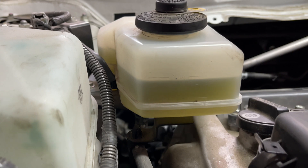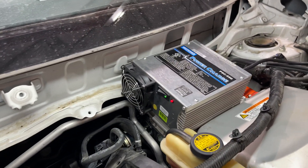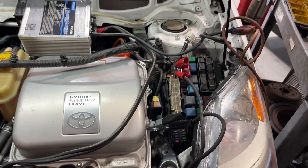One other note: you need to make sure that the brake fluid is always at max, checking it constantly. Also, I like to hook up a battery maintainer while doing this job because the car does a lot of stuff electronically, and I don't want to drain the battery.